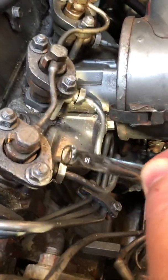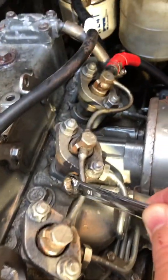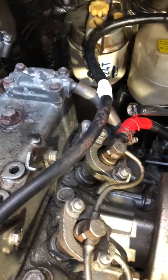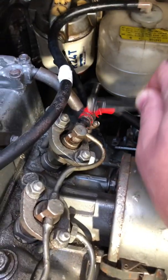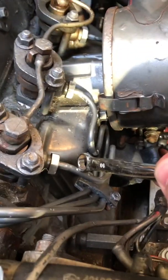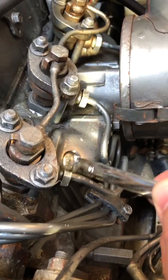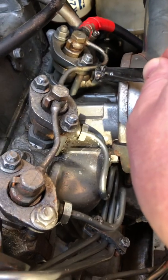From here, this is your high pressure pump. It goes to your high pressure fuel lines, and then here are your fuel injectors. I did not actually have to crack off my fuel injectors — I thought I was going to, but I didn't. This up here is your return line that goes back to your tank for the overflow. Some people, for some of these, it goes back to your secondary filter, but this goes back to my tank. The last resort would have been to crack the injectors off and then start it, but I didn't have to.